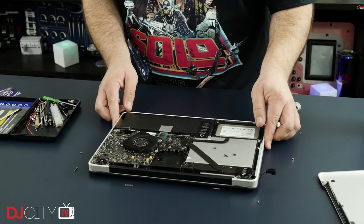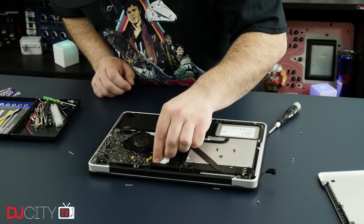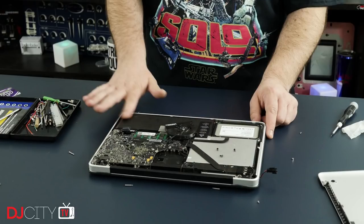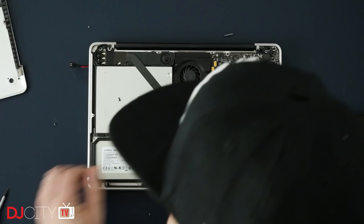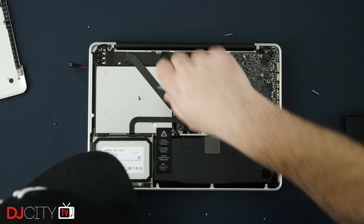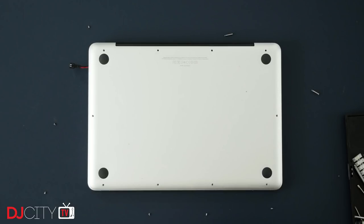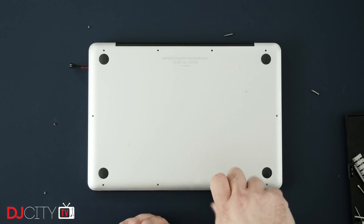Basically get to the point where you're going to remove the fan and replace it, but don't actually remove it. Just kind of pull it out, get your compressed air — your spray duster — get some screen wipes or something that's not going to damage the internals. A nice microfiber cloth, a soft bristle paintbrush. Just get in there and get all the crud out of the fan itself, out of the vents. The vents were really clogged up on my machine, because when you're DJing in smoky, dusty, moisture-rich environments, you're going to end up getting a lot of crud in those vents and in the fan.